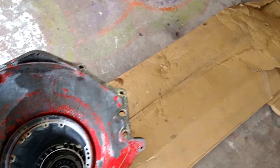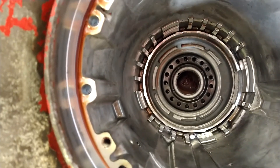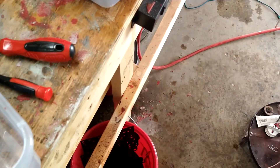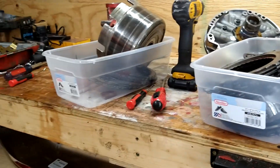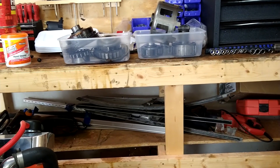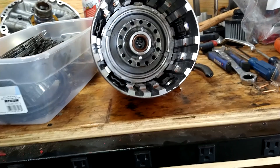I'm not going to go too far here. I was just worried because he said it needed to be rebuilt, but I don't see anything wrong. None of these gears are chewed up or anything. I think he just thought it needed to be rebuilt because this stuff has been sitting around. If it turns out I just got a really nice 700R4 for 75 bucks, man that's going to be a good deal. I checked all the planetary gears — I spun them around, they spin real smooth, there's no play in them. Everything seems pretty good to go. I'm going to get this all cleaned up and power wash it all.